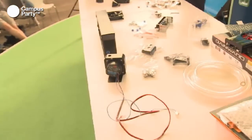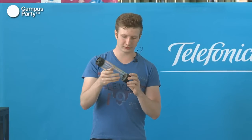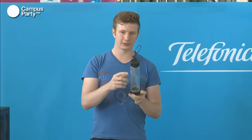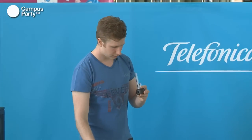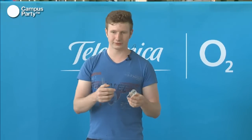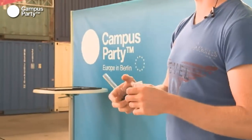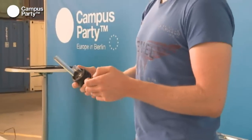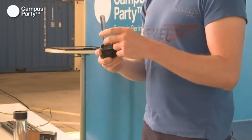So, next up is the reservoir. This particular reservoir is from EK, and you can buy several pieces of equipment for it, because when it comes standard, it has these little tubes inside which will allow you to take the intake up to the top to make the air go out of the system quicker. But you can also buy some equipment that will allow the air to get out of the system even faster, like this little tube. What this will do is that the water will go up in this tube, and then instead of making a huge turbulence inside the reservoir, it'll just go out of all these little holes and make sure that you're not having very much movement in the reservoir. Because if you have too much movement in the water, the air might just get sucked right around the system again, which is not anything that you would want.